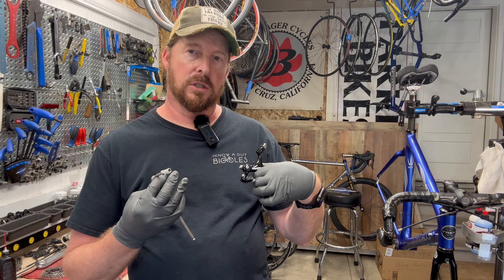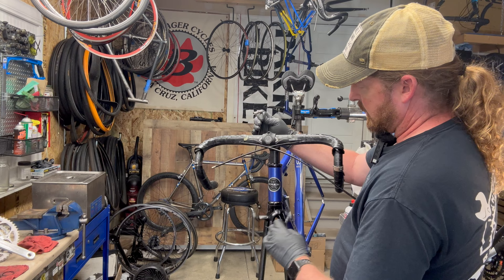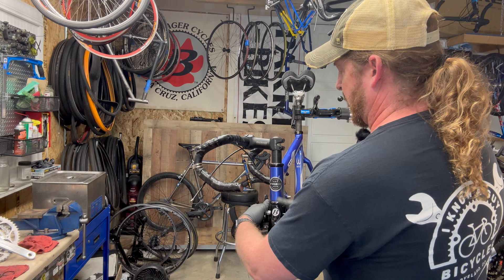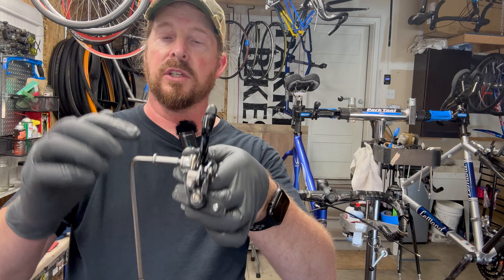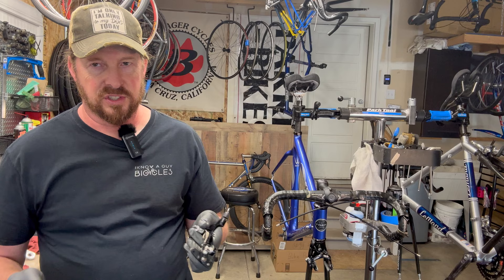You want to double check that those little screws are oriented in the backward direction on your bike. The front brake goes through the front fork — sometimes it's stiff because of paint. There are spacers on there; make sure you get those back on when reassembling, as they push the brake pads away from the fork. I tighten it only partially so I can adjust once the cables and housing are in place. The rear brake has a long cylinder, and these come in several different sizes.